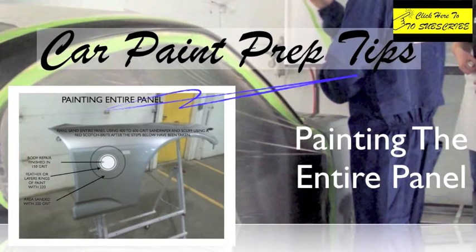So what I'll do is I'll go ahead and sand that, and then out past where I feather edged, I'm going to hit it with a little bit of 320, and that's where the primer's going to be. And then the rest of the panel, we're going to paint that entire panel, so we can just sand it with 400 to 600.